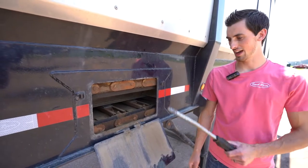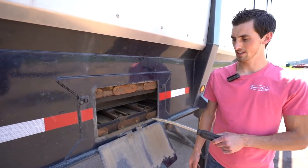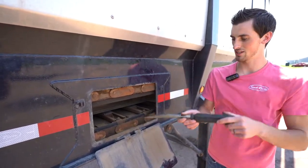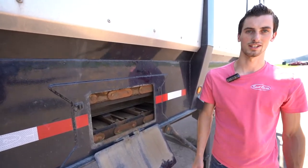Just to finish, I'd like to add that if your chain is not properly oiled and it's rusty and seized up, you're not going to get a proper reading doing either of these methods. As you can imagine, if it was all stuck together in the pins and you pry, it's going to lift as a unit even if it's not tensioned right.